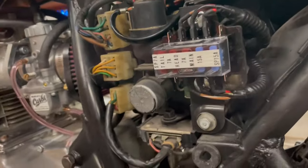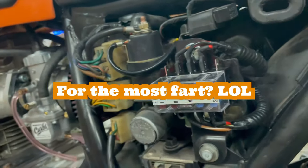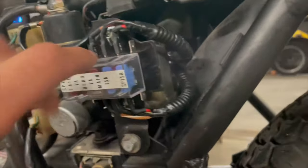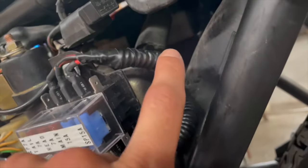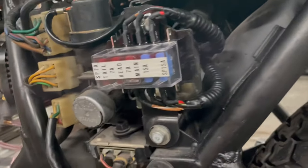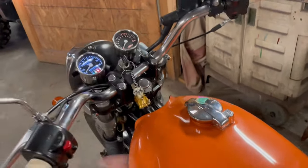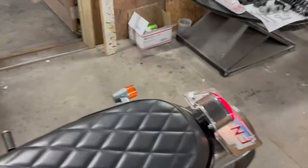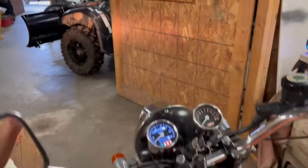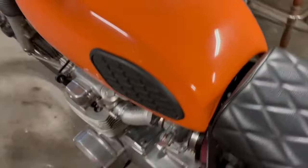This thing is all wrapped up now. I really like how it has kind of an OEM aesthetic — it goes in the same position and mounts up the same way. Obviously a little different since we have sheathing on two sets of wires, but I went ahead and wrapped some black tape around that, got the heat shrink on the female spade terminals, and got that sticker on there. Really happy with how it all turned out. You can tell the main fuse is working because when I turn the switch the lights come on, the brakes come on, and the headlights are working.